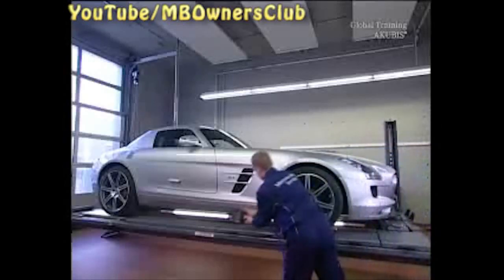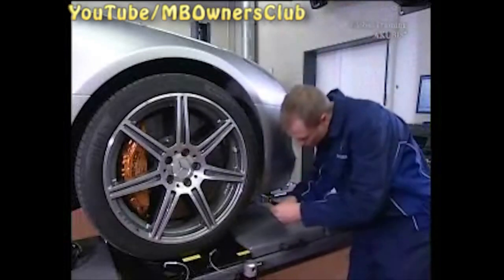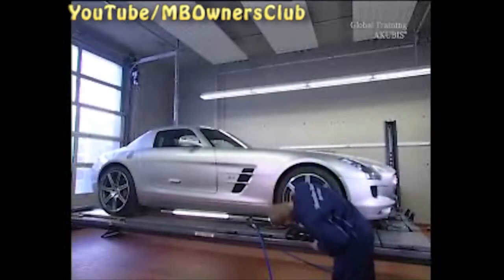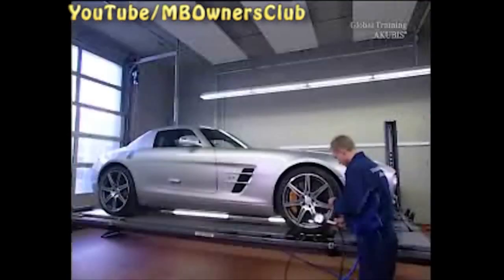The vehicle may not be loaded. Measure all three profile depths on all of the tires and write down the values. Inspect the wheels and tires for damage. Then check the tire pressure on all wheels and write down these measurements too.